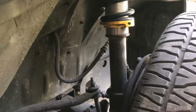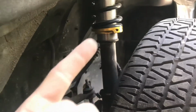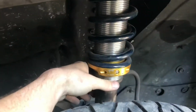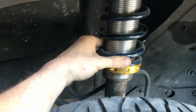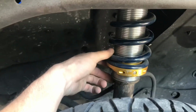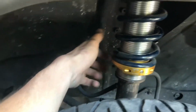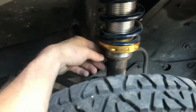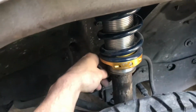As you can see, there's the spring perch right there, and then it's got the little set screw, and then it's got whatever kind of springs these are. But everything's really nice. It really seems really solid. I put in new XLG struts because the old struts were blown, and these were cheap compared to the Koni Yellows or whatever that people run from the MR2s.